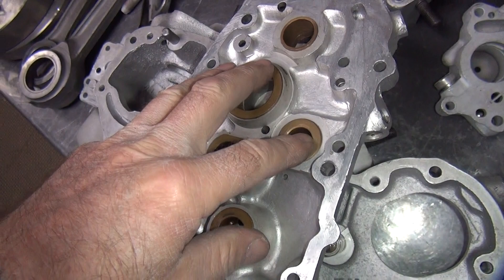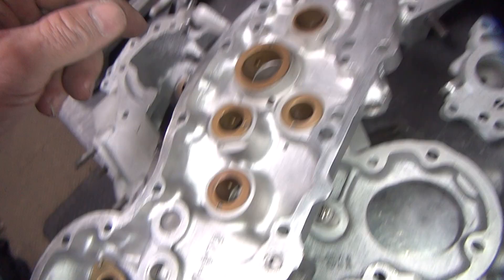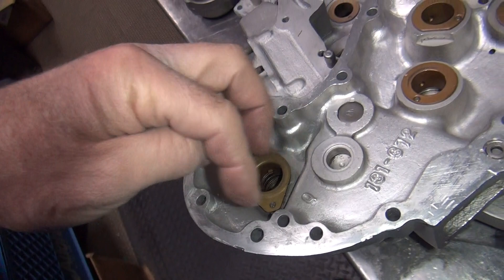You're always breathing through this tube into your primary. This one over here takes up whatever is left over, which is your breather system that goes past the generator gear here, which seals against that and has a slinger in it. That's supposed to separate the oil from the air and then just dumps out here onto the ground. That's how that system works.